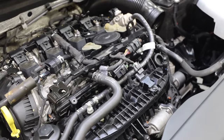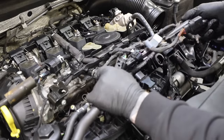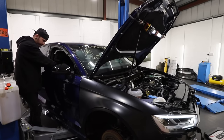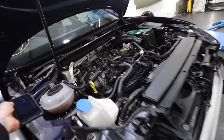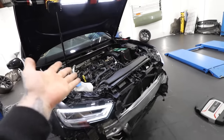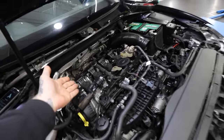So it's back on with the old injectors. Pretty easy to remove - you can do this from the top. Just disconnect the fuel rail and then pop it all out. If this doesn't fix it, my next step would probably be the coil packs as we did change the spark plugs before. I was waiting for the fan to come on - I could see the cooling temperature sensor getting to about 90 degrees and it was worrying me because the fan never came on, but now it's come on. Since it's got to temperature, she seems to be running sweet. Whether those injectors did it or not, it might just run lumpy when it's cold - could be the coil packs - but she's running good now.